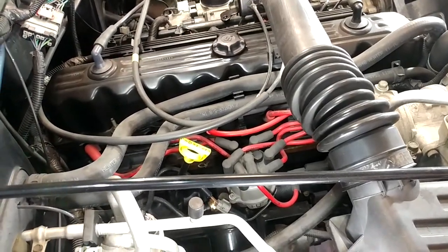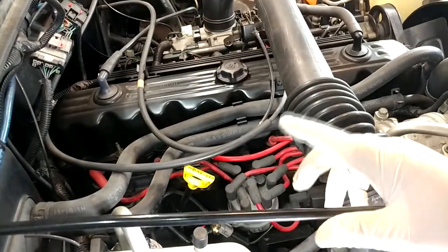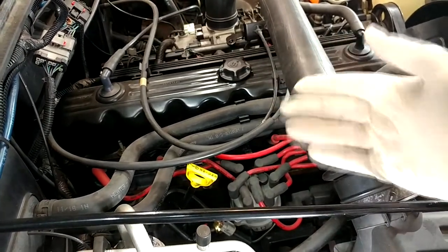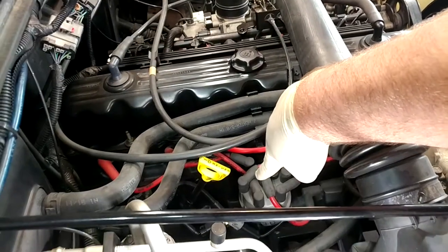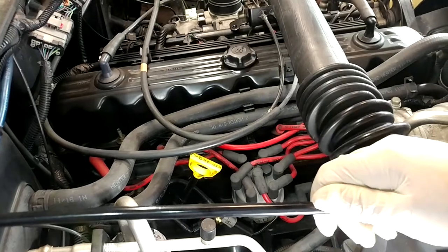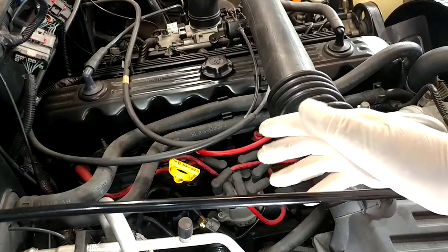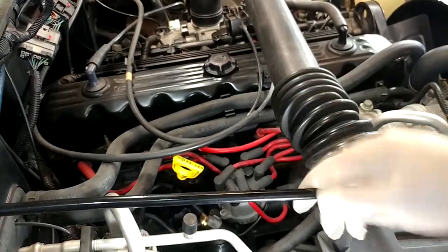It's still drive-by cable and it still runs a regular old distributor cap and rotor. There's a somewhat serious chance none of you guys out there have ever seen a distributor before — a lot of cars went to coil pack ignitions back in the mid-90s. This engine is basically a design that goes back about 100 years. All of our spark plug wires go into a cap, and inside the cap there's a little whirly guy called a rotor and that's actually what controls which cylinder fires when.